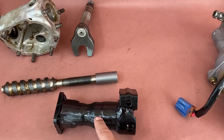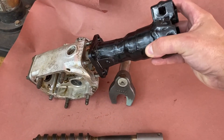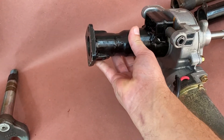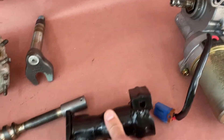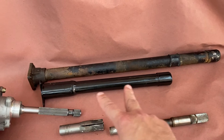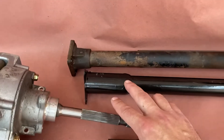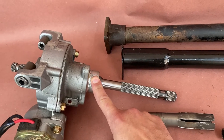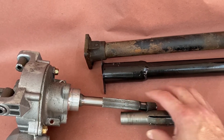This is kind of something I cobbled together. This is the original drive shaft component that hooks on to the base here. And then this other end is something that I rigged up that will kind of tie into that little bolt right there to hold everything steady. Just got the box. This is the new upper steering shaft housing — that's the original back there. This steering shaft housing uses the part that came with the Saturn Vue power steering box here. This is going to bolt on. This piece came with the Saturn Vue box as well — it had a steering column.